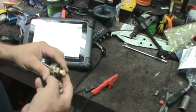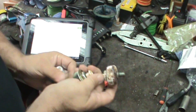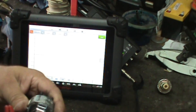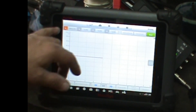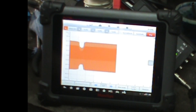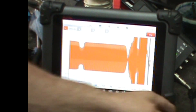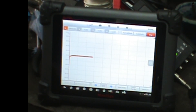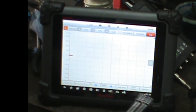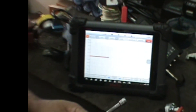This is going to be a no-brainer — that's the new one, and those are the two old ones. Want to guess which one's bad? I'm going to start with the new sensor. I'm on a 100 millivolt AC scale, one second per division. There it goes — that's called a good connection. I'll just give it a little tap with my specialty hammer.